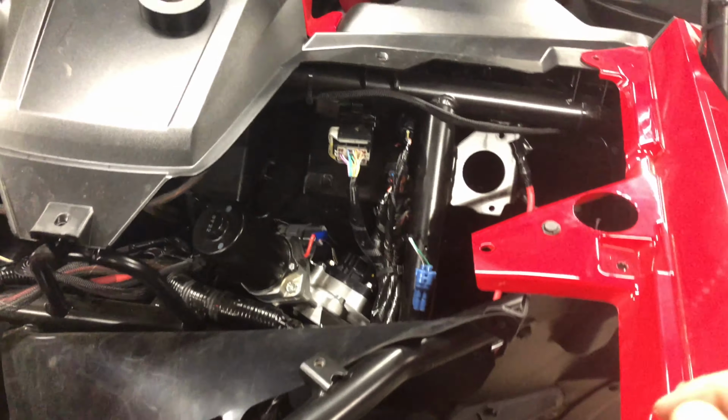So inside, got a slew of wires in here. All of these red wires right here are accessory key on wires. And what I did is I made 7 leads coming from one, soldered them all together, and then ran them to that accessory plug I showed you up here, the waterproof one. So those are going to provide the lower light power when the key's on.